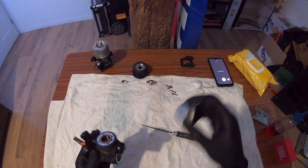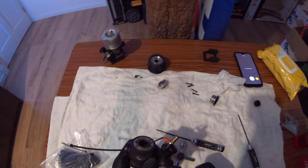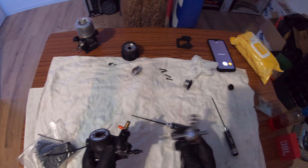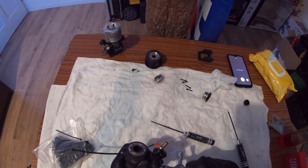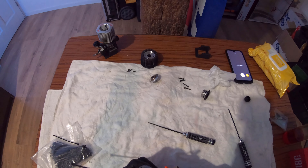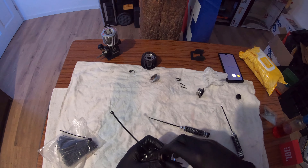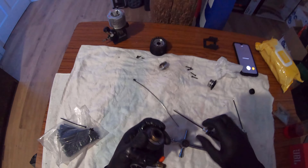This is what I always use to remove the piston. I put the zip tie in like that, then get either a flywheel or just a bolt like this, put that on the crank, get your wrench out and tighten it, and then it'll most likely pop up - and there you go, you see that pulls it right out. Remove the zip tie and then you can use something like a little screwdriver down the bottom and out it comes.